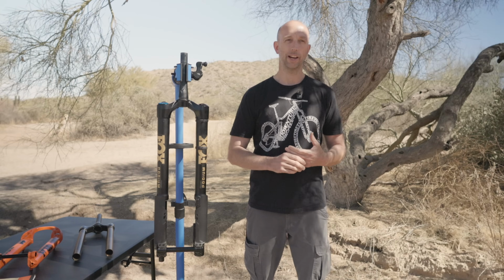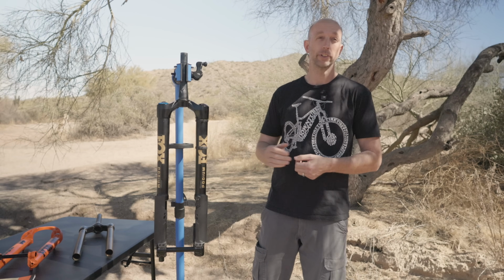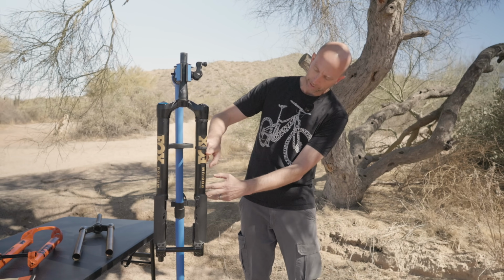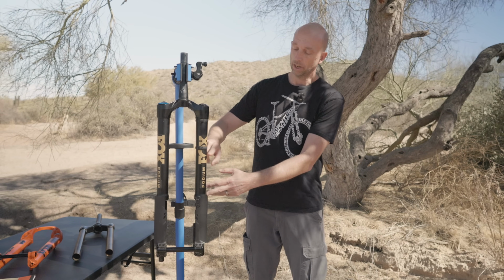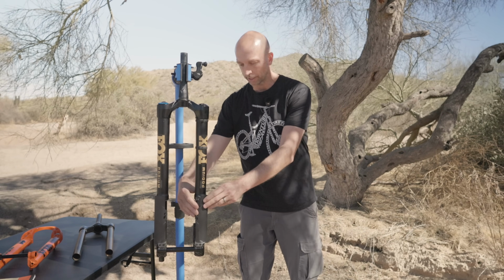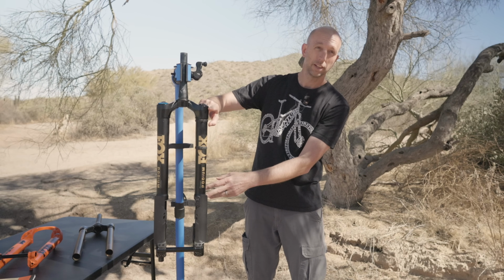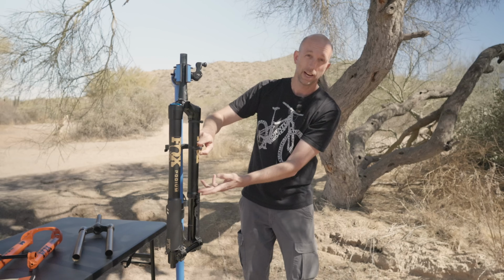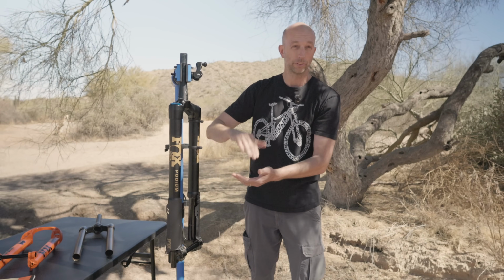An inverted chassis operates at lower friction when the fork is loaded. And how it operates at lower friction: in an inverted chassis, we're able to get greater bushing separation compared to a conventional fork. The lower stanchion that's covered by the guards here can travel up into the crown. So that allows us to move this upper bushing up even farther, and that reduces the contact pressure on the bushings, which reduces the friction.